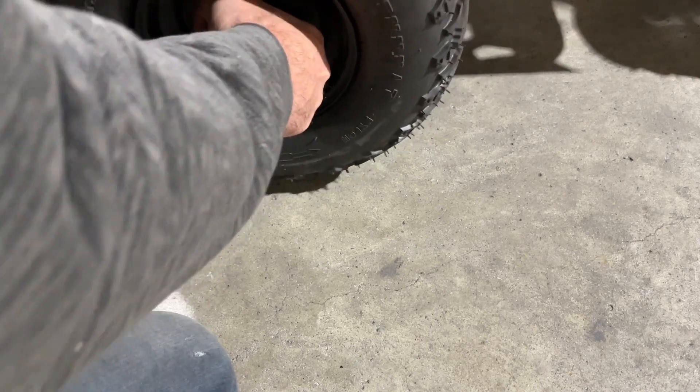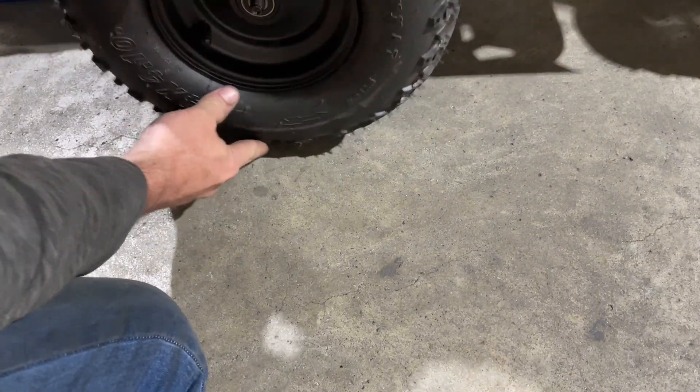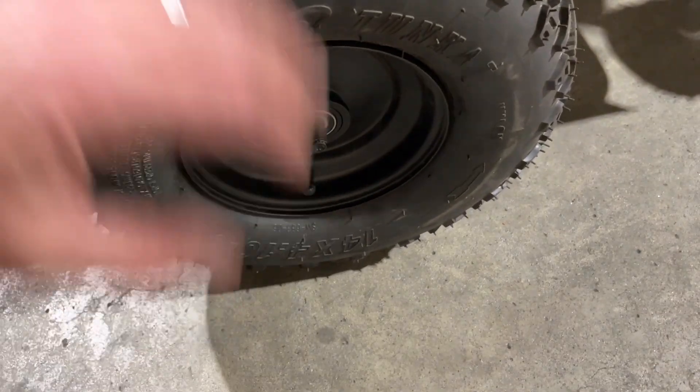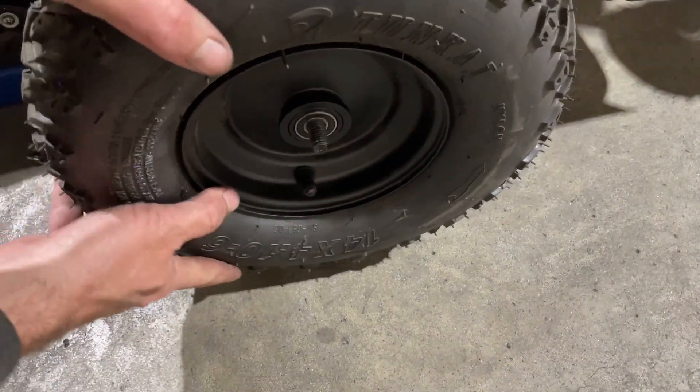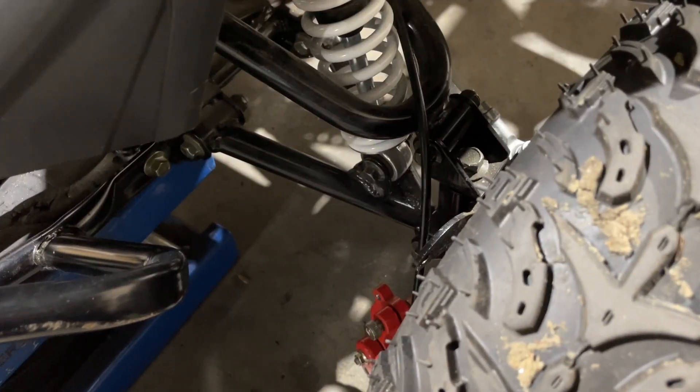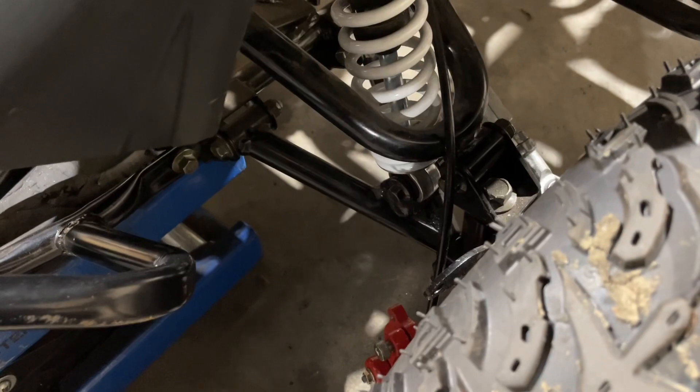You would just pick up your new tire, take your rotor, and put your three bolts back in. Don't tighten that one all the way down right away — make sure you get your other ones in first. Tighten them up — you want to tighten these enough that they're tight but not so tight that you strip the bolt or strip where your Allen key goes in. Now our tire can go back on. If you're having a hard time, just wiggle it back and forth — there's a little spacer in there and you just have to work the axle on it.